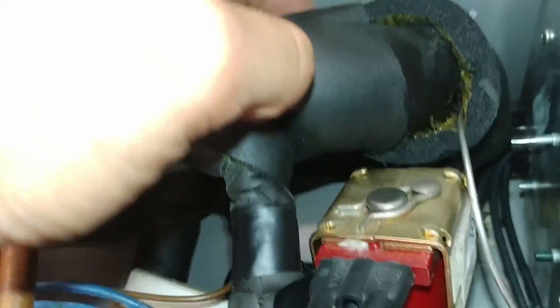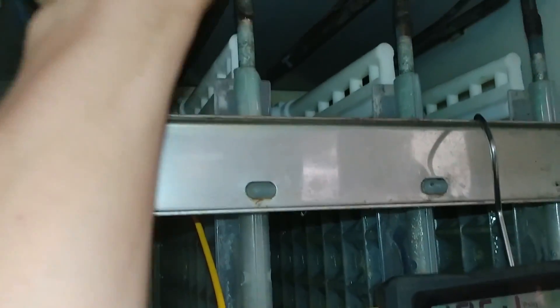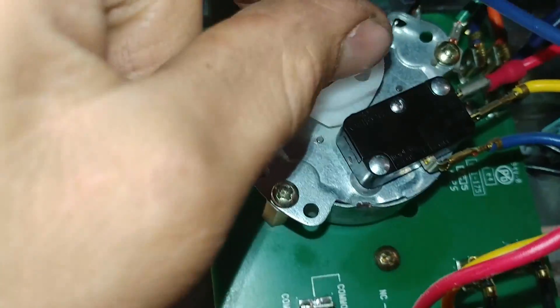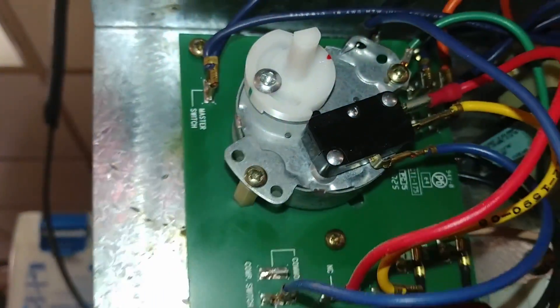It's measuring the temperature on this line. As soon as that temperature gets down to whatever we have this set to — in the example I said just now, it would be 17 degrees. So right at the beginning of the freeze cycle it's going to be like 40 or 50 degrees, and it's going to have to cool down all the water and make enough ice to the point where this gets down to 17. Then it will switch into freeze, and this will slowly turn around in a circle as it finishes the freeze cycle, and then when it gets to there, back into the harvest.